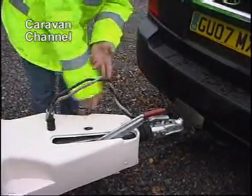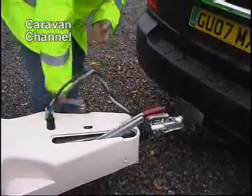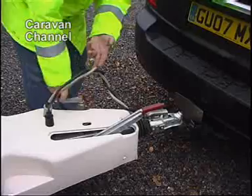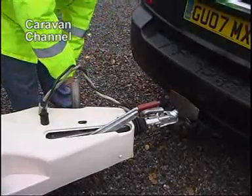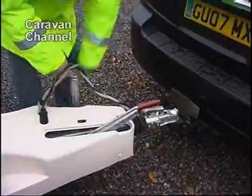Once we're happy, we're going to stow the wheel right the way away in its tube, lining the wheel up with the cutouts, which are quite apparent when you have a look at the tube, making sure it's secure, and then releasing the clamp on the whole wheel assembly, bringing the wheel up as high as it can come, and locking that clamp off.